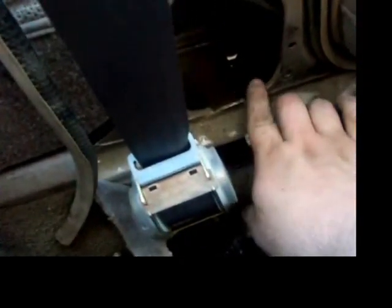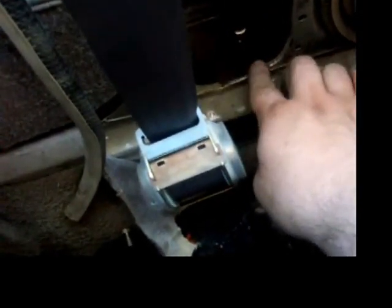So, there's nowhere to bolt this to, this part down here, because the coupes have the piece that comes up right here to mount it inside this hole where it's supposed to be. So I'm assuming the sedan seat belts for Canada, or the newer wagons or whatever, must bolt to these three 10mm here.